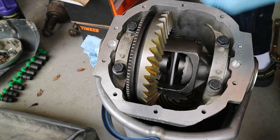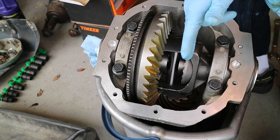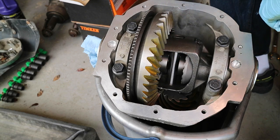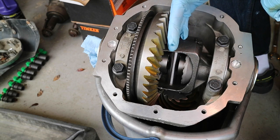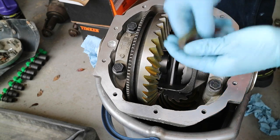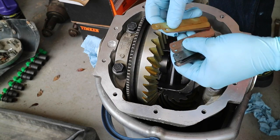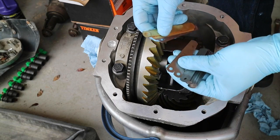We're going to be prying with a screwdriver and using a set of gauges to test the clearances. We want our spacer-to-pin clearance to be no more than 8 thousandths difference side to side. The minimum clearance needs to be 6 thousandths and the maximum is 20 thousandths. If you have 6 thousandths on one side, you can't have more than 14 on the other.